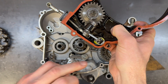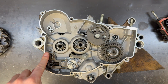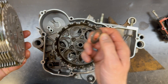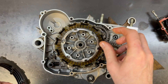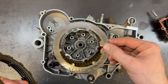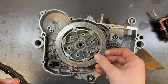This right side clutch cover has got one dowel pin there and I've got one in my hand. I'm not changing this clutch cover gasket. Now that inner race — I can put the outer hub on. Drop in the inner hub, then start with friction plates. I'm not 100% sure if this is the stock clutch — a lot of the Betas have a judder spring; this one doesn't, so this might be an aftermarket set of plates. If yours is a little different, let me know in the comments.